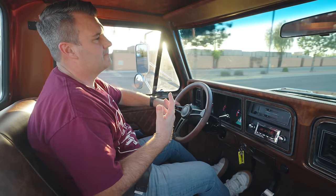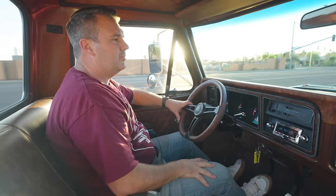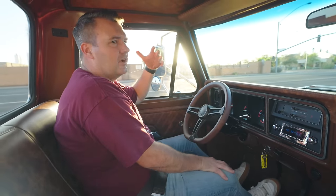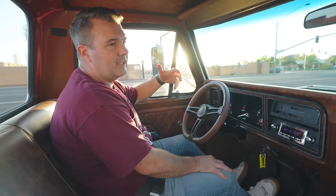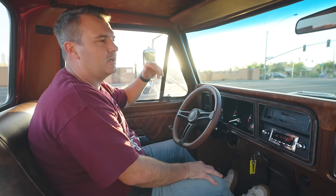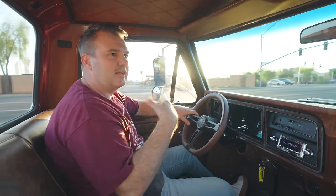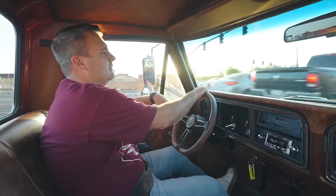We are riding on coilovers, so you're going to have a little stiffer feeling. We do make the same chassis set up lower and you'll be about 6 inches off the ground. We also make it with air ride and you can let all the air out and lay frame. The air ride is actually a little bit more comfortable - a little smoother because you are on air. It does take away some of the extra bounciness, but it's also a little more finicky because you've got to worry about air lines and making sure they don't leak, and you always have to have air.